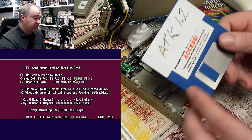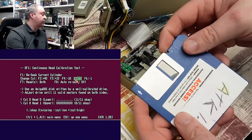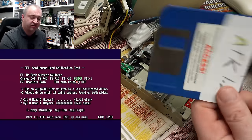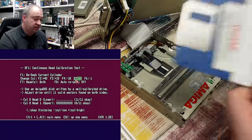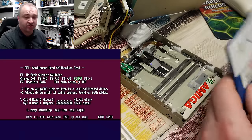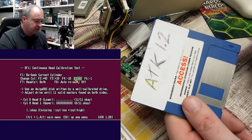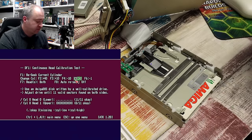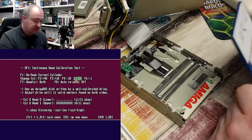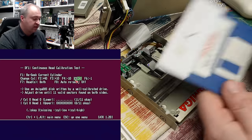The issue with the original disc — my copy of Amiga Test Kit — is the disc itself. Just at the start of the disc there are what look like almost grooves in the disc surface. Unfortunately a lot of my old discs just don't seem to last anymore — possibly down to how they were stored back in the day. Like a lot of this stuff, it all just went up into the roof space for many years. It would have been dry, but definitely prone to quite dramatic temperature swings between hot and cold — that's not good for the magnetic surface. Even discs that do still work, after multiple uses the surface just seems to break down. So this one is for the bin.